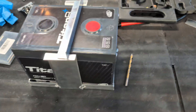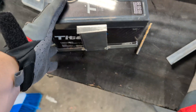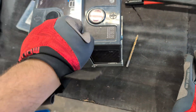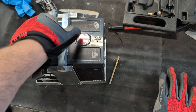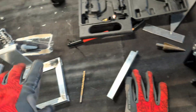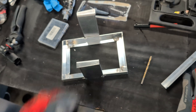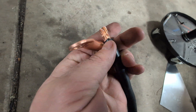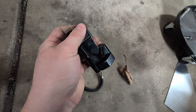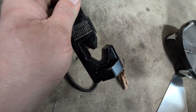Here's what I came up with for the battery tray. The battery sits in it, the tray gets bolted down to the chassis, and then this plate goes on top and bolts down to hold it. This battery only weighs about seven pounds so it doesn't need much to hold it in. I went with aluminum just to keep it lightweight. For the connector, if you're modifying the length like I am, you want to make sure you get enough cleaned off so it fits inside. I'm using a crimper that just uses a hammer — you put the fitting inside and smack it.